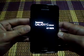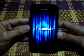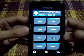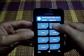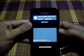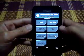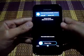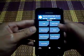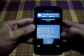I am just going to boot up into recovery mode. Team Win Recovery, TWRP. So first you are going to wipe everything — wipe, check, wipe it, go back, click reset, wipe, go back again, go to Dalvik, check, and swipe.